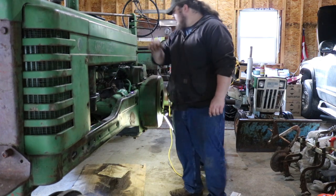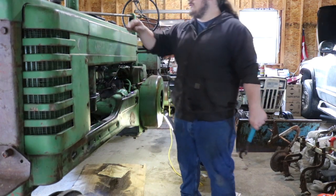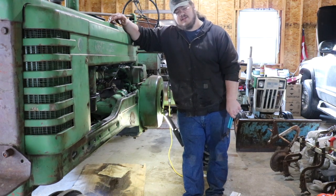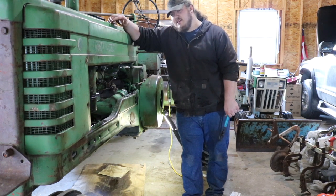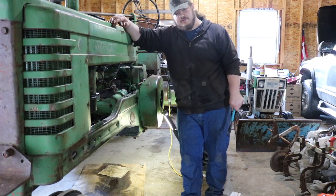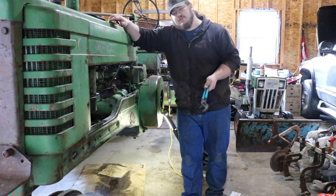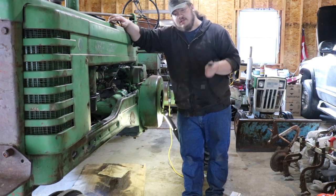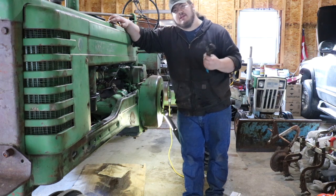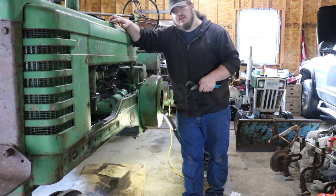What you're gonna need is an 11/16ths wrench — I use these here, they work real good for getting the oil fill off the top of the engine and also for getting the oil filter cap off. It's like an inch and 3/16ths but I can't find my bigger wrenches. I'll put down below the oil filter, how much oil, and the type of oil I used. I use a Napa Gold filter — I think they're made by Wix. I use Rotella 15-40 diesel oil, it works really good in these old things, and it's seven quarts.